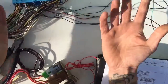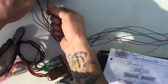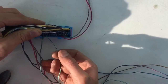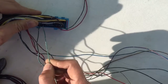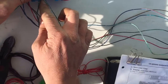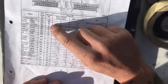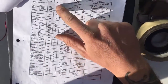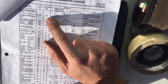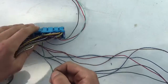You can do this on a bus, a van, or any other swap you're doing — that's just how I do it, feel free to do it differently. This next wire is a light green/black and it's actually the second one to the right on the middle section. That is pin 82 — the neutral position switch. I'm just going to label that right now.